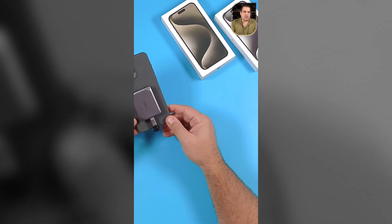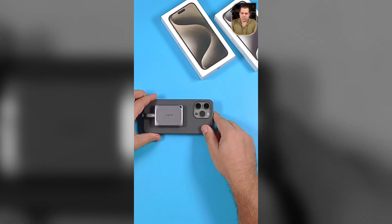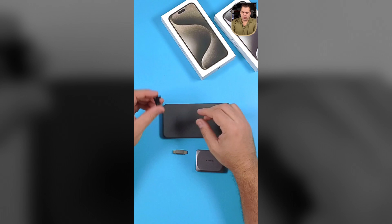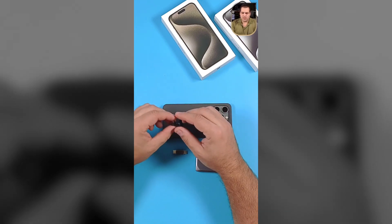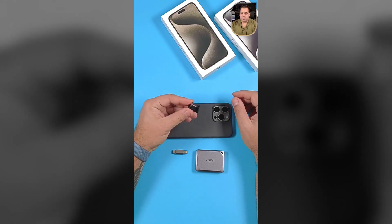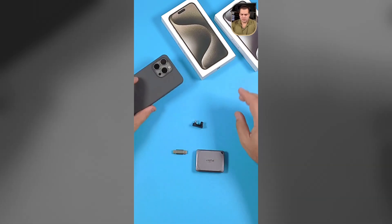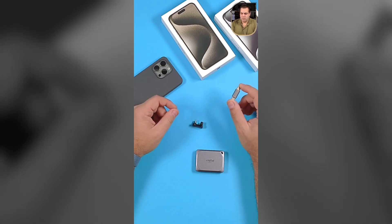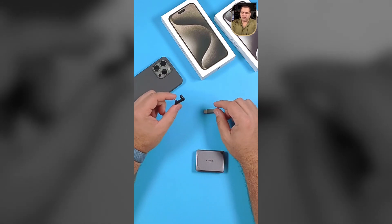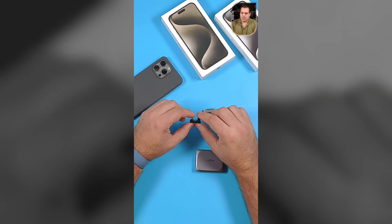So this is what it looks like when it's all together. I'm running with this Crucial SSD. So let's break it down a little bit. I'll put links to all the parts in the comments. We got this little USB-C U or 180-degree adapter. And then we got a USB-C male-to-male. It would be nice to get one that's actually USB-C male-to-male on both sides, but I haven't seen one that's actually good for the data rate. I've seen charging ones, but that's not what we want — we want to still get the max rate through it.